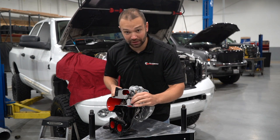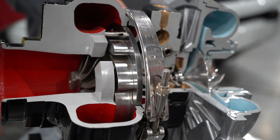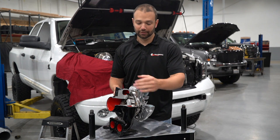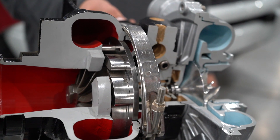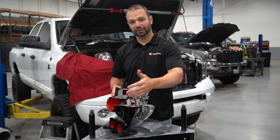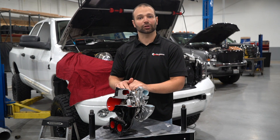People are always surprised by how much power you can make on a small turbocharger in the valley. The vanes are relatively closed during spool-up, which really helps the turbocharger come to life. The small turbocharger determines how quickly the system spools up — don't forget that. As it spools up, exhaust energy goes to that big turbocharger and brings it to life. As the big turbocharger comes to life, the vane pack opens, which slows shaft speed on the small turbocharger — but that big turbocharger is feeding it. Eventually, all the exhaust vanes come all the way open, the exhaust energy has a freer ride through the turbine assembly, and it's not choked up.